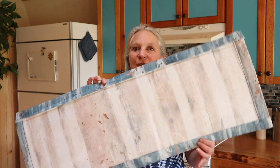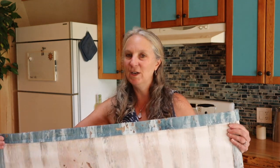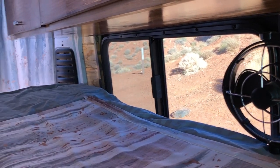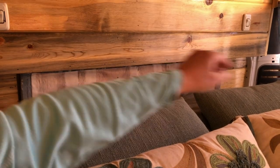The first set of blinds that I made for the van were like this, and these are specifically for the bunk windows. And all I did was use Easy Cool, and I had magnets running across the edge here. And then we used a stick-on magnet that framed around each one of the windows. Now, the reason we had to do this is because the windows that we installed didn't have any kind of magnetic or metal parts, they're all aluminum, so nothing would stick directly to the window. So we had to make a blind or a covering that would adhere to the framing around the window.